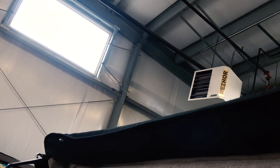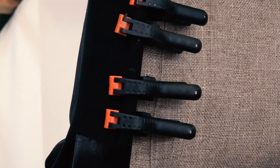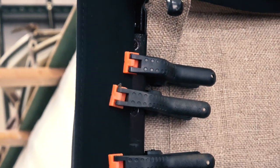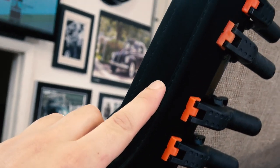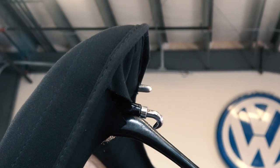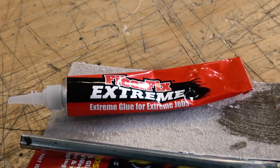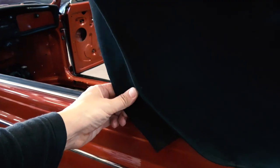We punch the holes for the pins — make sure those guide pins are lined up with the holes on the top frame above the glass. See how I have that seam angled down; it might seem extreme but it's going to pull. We got some clamps for how we glue down the flap on the frame here. Make sure the seam is all even with the frame — you want that nice and even. We use Fiber Fix Extreme Glue for extreme jobs, and that worked really, really well. It's very strong stuff because the top's going to be moving back and forth.